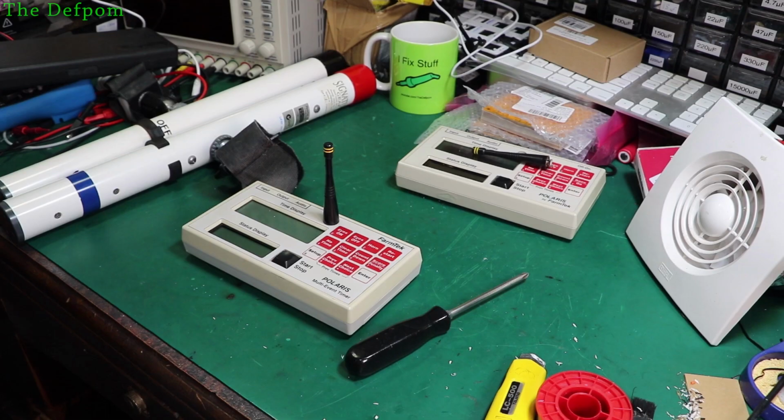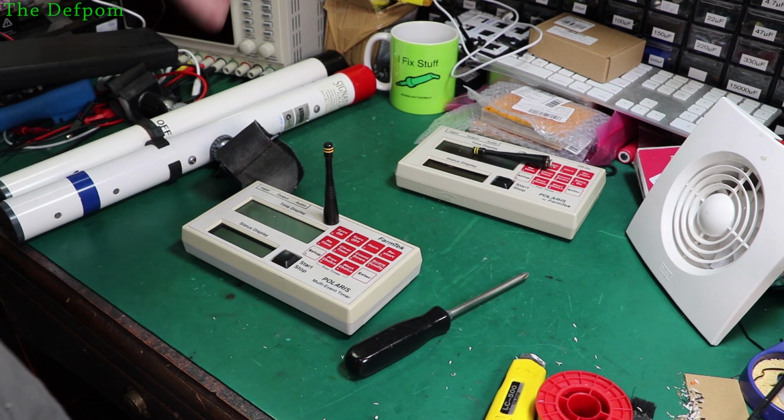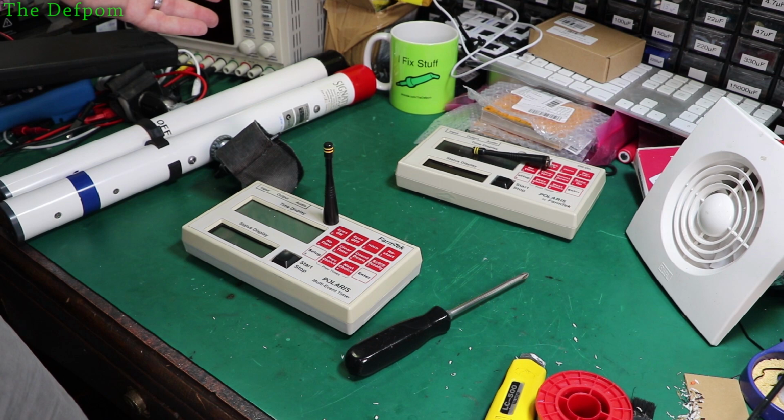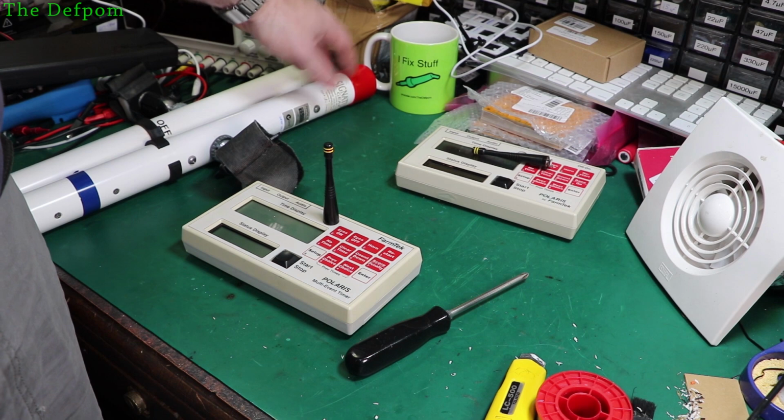Well, I hope you found it interesting. I don't have an outcome, really. It works. The range doesn't look right. I investigated the transmitter assembly that's in here, the TXM900, was it? Something like that, the link transmitter. Obsolete parts, can't get them anymore. So if that's the problem, then that might need re-engineering by the manufacturer. If that is getting weak, there's nothing I can do.